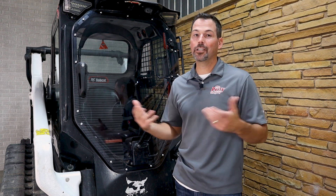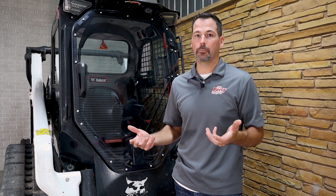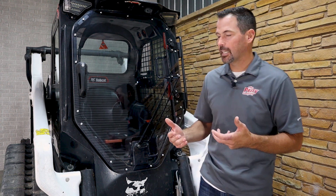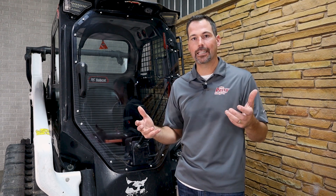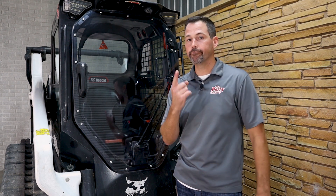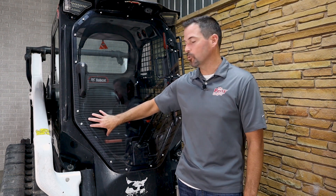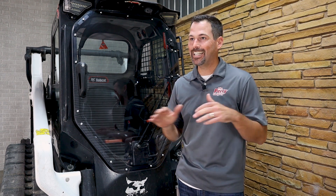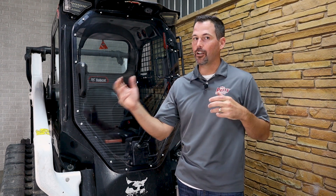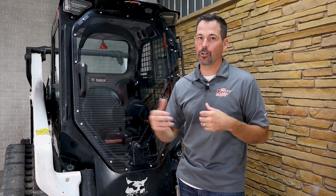Number three, we're not using laminated polycarbonate — we're using monolithic polycarbonate. The difference is laminated is several sheets of polycarbonate laminated together. What can happen is those can start to delaminate over time, especially at the edge. You start getting dust, dirt, debris — it looks horrible, and you have to question the structural integrity at that point. With our monolithic, it's one piece. There's no lamination. You get the dual-sided scratch resistant on both sides with a monolithic piece. Anytime you have the option, whether it's laminated or monolithic, personally I'd go monolithic.